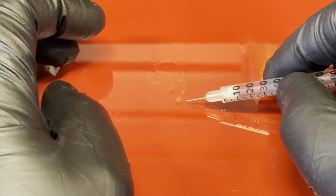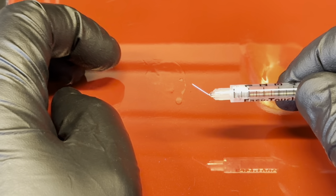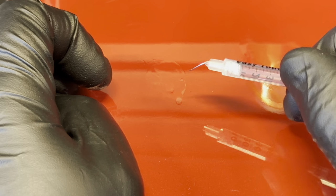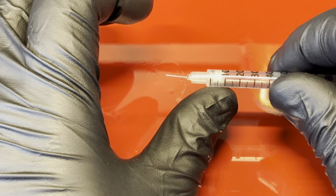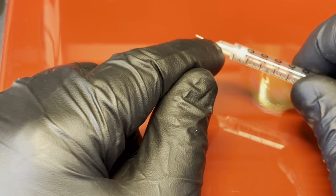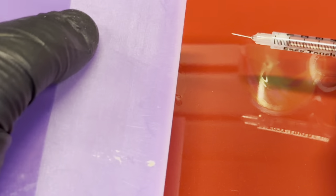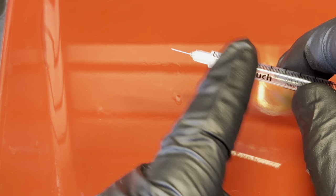Keep in mind: if you end up pushing down on this needle and bending it, at that point the needle is toast — throw it away. Chances are you'll be fighting to get it at the right angle and gouging or scouring the paint. You could try to straighten it and reuse it, but when you bend these, it tends to bend right at the tip and becomes a pinch point, so as you're trying to evacuate fluid into the syringe, it gets caught at that pinch point and doesn't flow through.